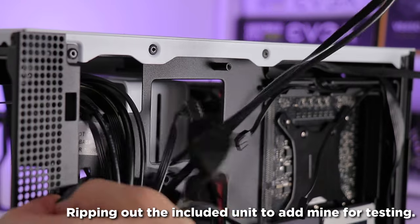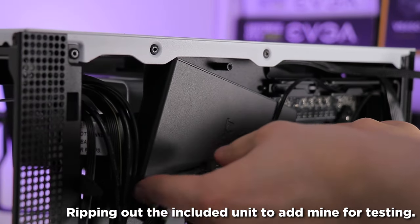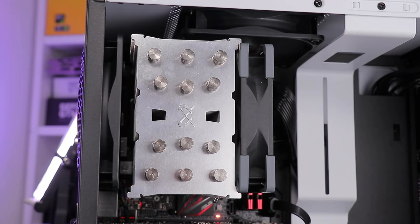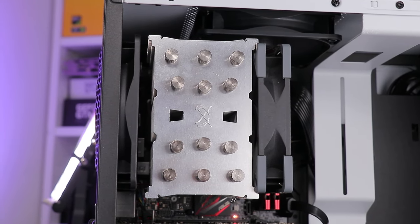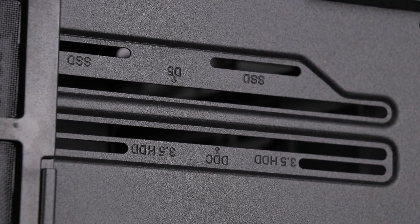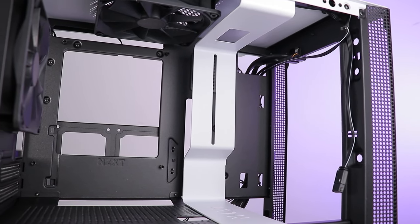If you find you're having problems, get in touch with NZXT to see if they can send a replacement unit or resolve teething issues with the software. You've got space for pretty much any CPU cooler you want with 166mm of CPU cooler clearance. I've got the Scythe Mugen 5 in here, which is 155mm tall — and even this is just 7mm from the tip of the rear fan. So if you go for a thicker or deeper CPU cooler, you might need to factor in moving that rear fan elsewhere. There is also mounting support in the basement for pumps, and the draping metal piece has a slot in the centre to mount a reservoir.